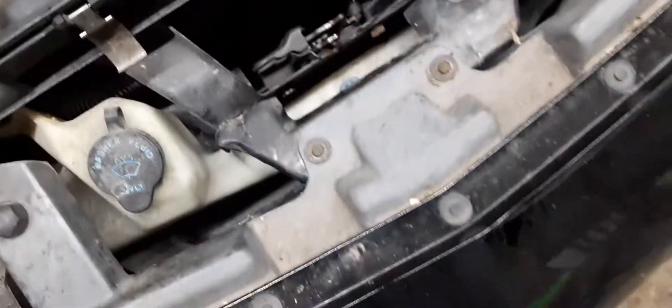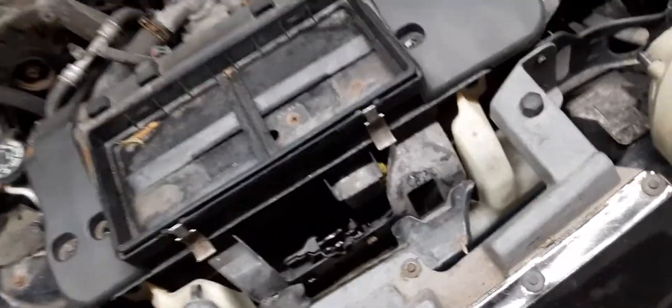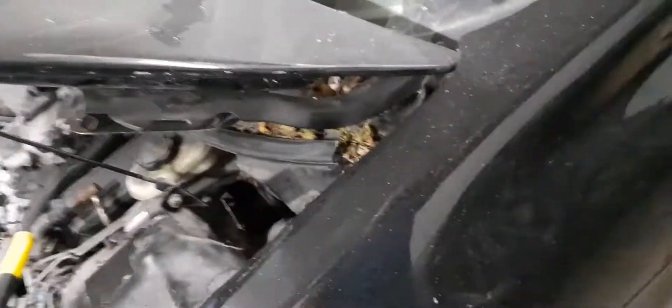The radiator is held on to it, so that's fine. Really, that's all you need: the bumper, two headlights, two fenders, those fender brackets, and the brackets on the insides of the door jams. The hood brackets you can leave the same too. I had issues with this hood — the hood was like three quarters of an inch off because it's just a piece of shit. But that bracket up in there for the fender, you can leave that one the same.